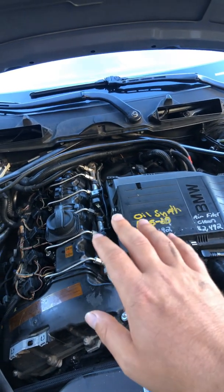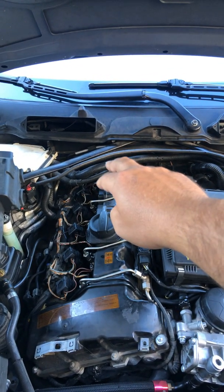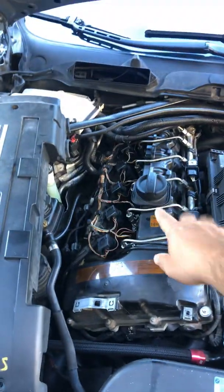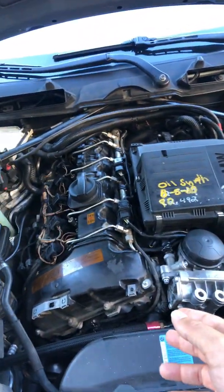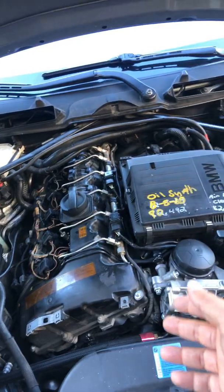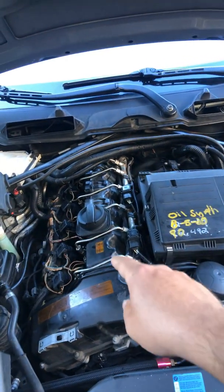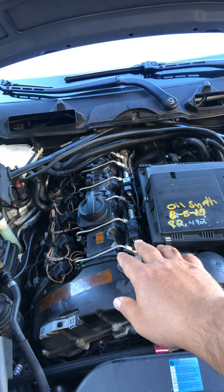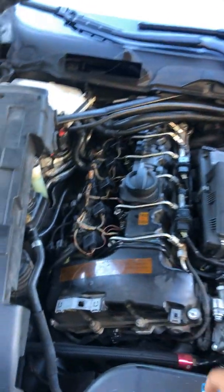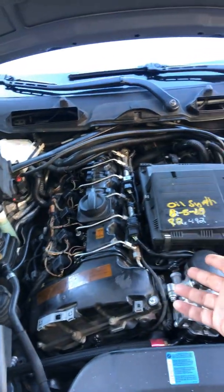Other than the intake valves, I've changed cylinders 5, 6, and 4 to index 12 injectors. These are index 8, 7, and 7. I got these at the junkyard. Yeah, I know, junkyard. But listen, this is what I'm trying to explain to you guys. If you want to do these cars, you're going to pay money. If you want to try to cheap out, it may hit you in the end. But these injectors I got here, I bench tested them, they don't leak. All right, I got 6 of these. I figure probably in the future I'll get index 12s, but for now, since these aren't leaking, I'm just going to leave them alone. If something's not broke, don't fix it.